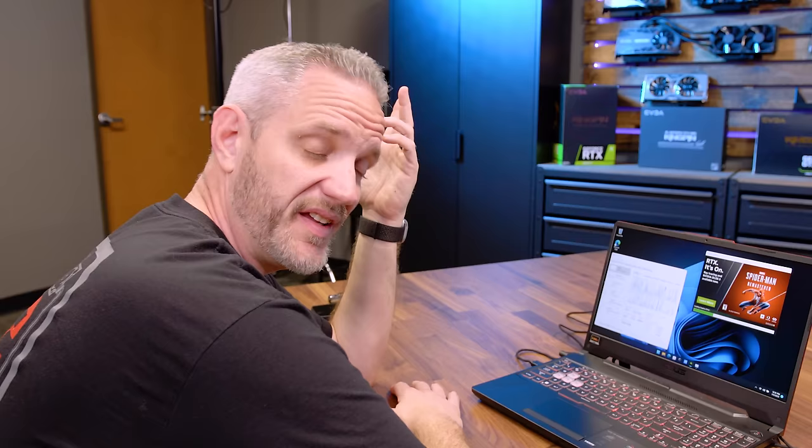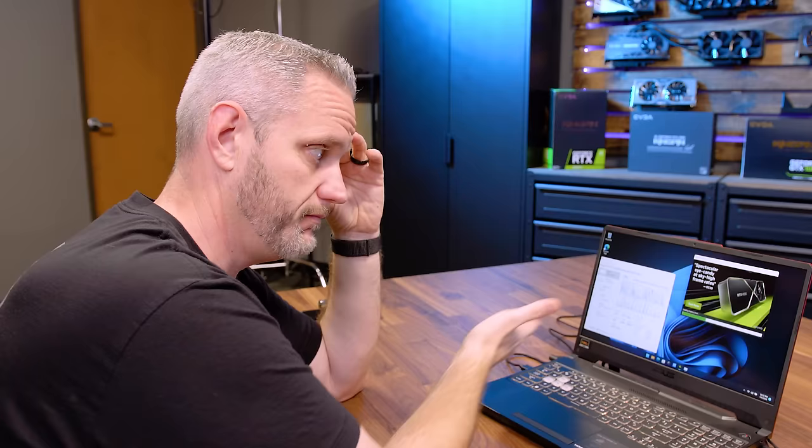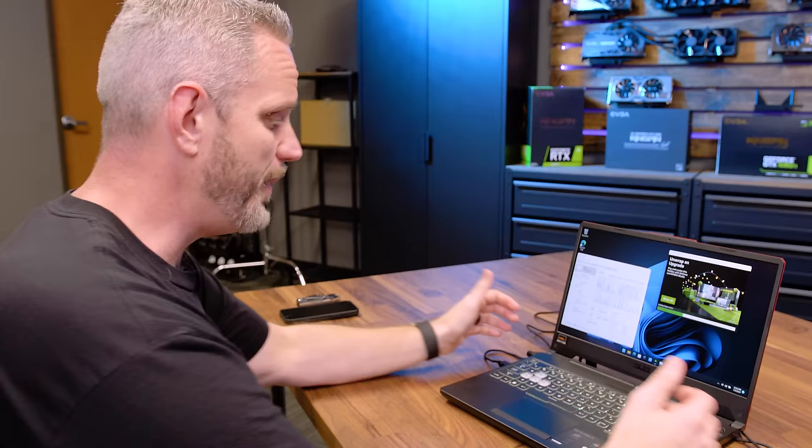But the fact that you have 4 cores, 8 threads, it could use some more VRAM or regular system RAM, but it also has the iGPU, which means QuickSync would be available to you in anything that uses QuickSync, including OBS, Premiere, Photoshop, all the stuff that does integrate with QuickSync. Plus you have the discrete GPU as well. So this would actually make a very powerful, inexpensive mobile productivity rig, if you will.